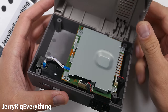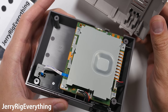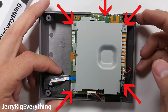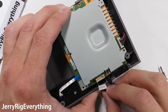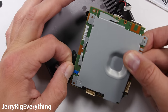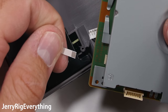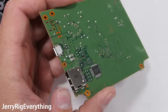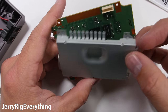It's pretty simple on the inside, a lot less complicated than the original NES that I opened up a few years ago on my channel — I'll link that video at the end of this one. We can see 5 more screws holding down the main board to the plastic frame. Before the main board can be lifted out, there are three connections we have to remove: two with super tight white plugs, and one little ribbon cable off to the side. This is the same type of ribbon we've seen in multiple cell phones before. Now that the board is out, we can see the micro USB and HDMI ports are both soldered to the main board — nothing's really modular here.